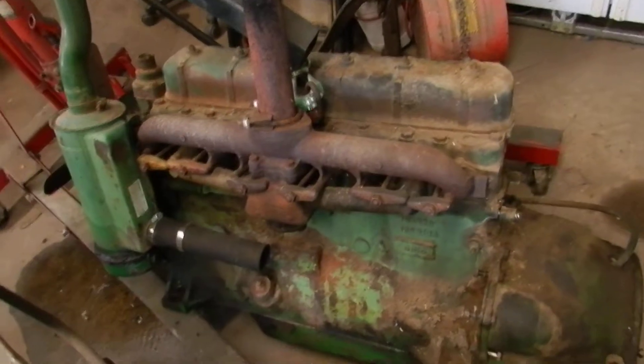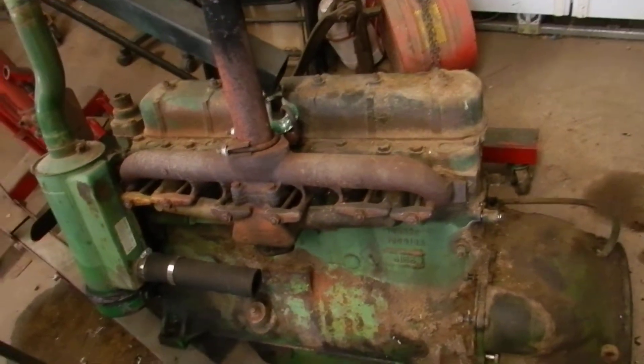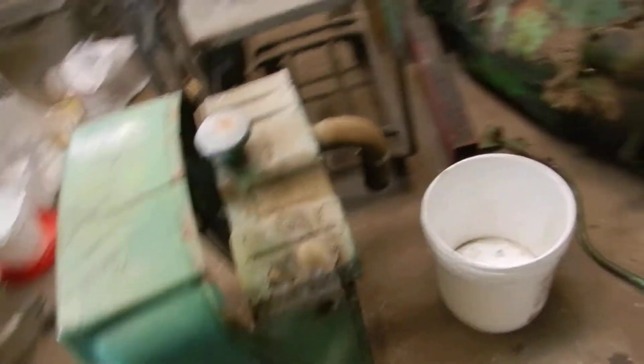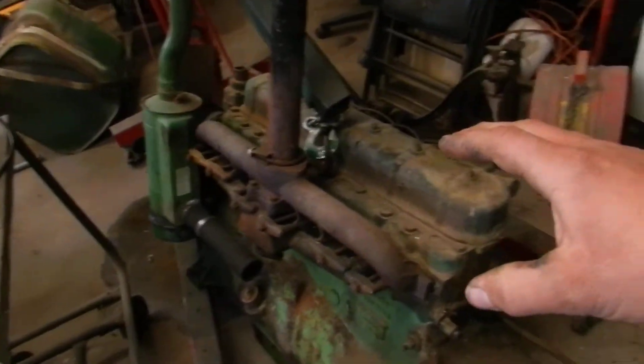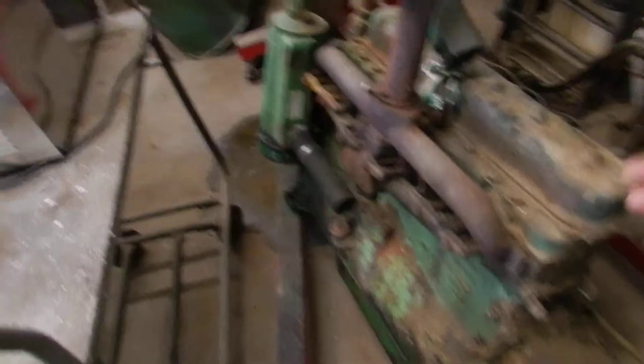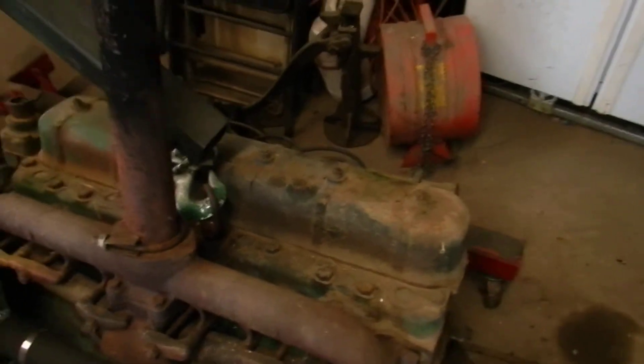One thing I will say that was definitely interesting — I got the factory service manual to help me out. It's kind of interesting to see how they describe certain procedures. How it describes the procedure to remove this is it actually tells you to remove the engine with the radiator and the dash all attached to each other. It says in the description, make sure you check how good your radiator hoses are, because that's the only thing going to be holding it to the engine. So they have you lifting the engine up and out with the radiator attached, full of coolant, so you don't have to drain it, and then it actually tells you to just lay the dash on top of the valve cover and lift the whole works as one unit.